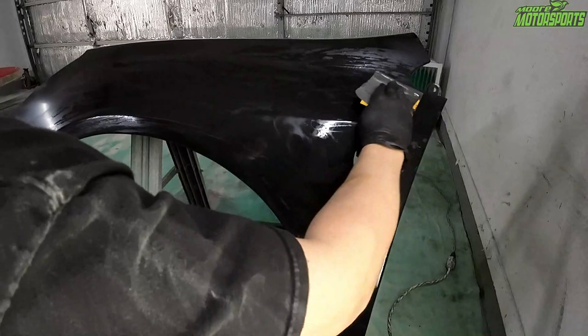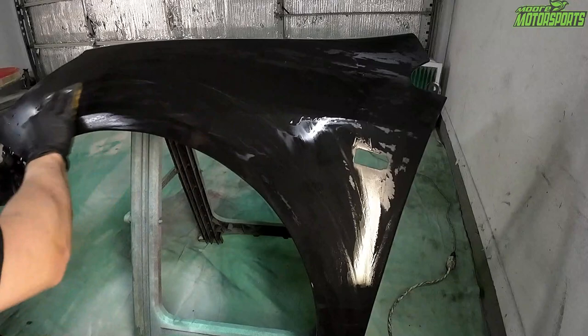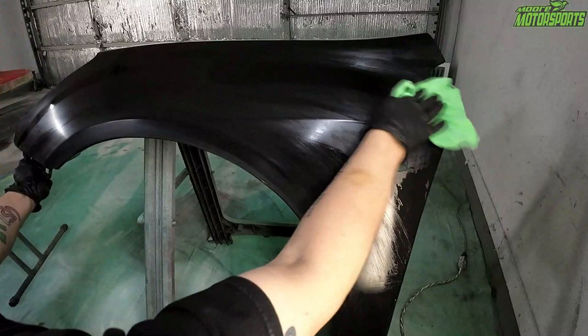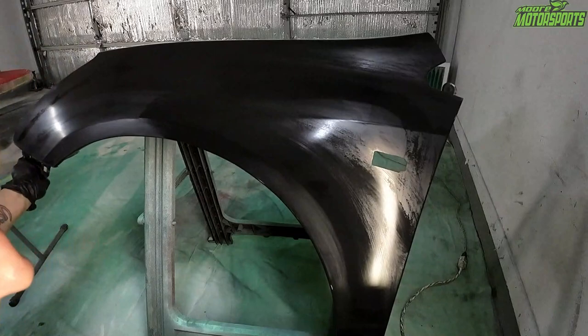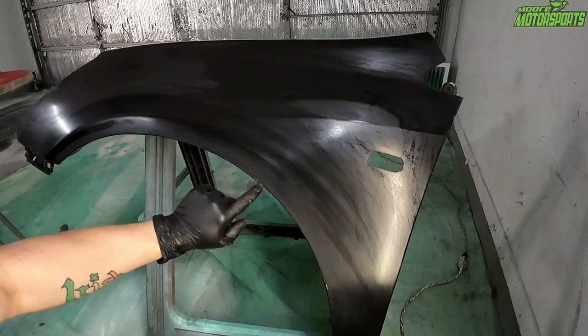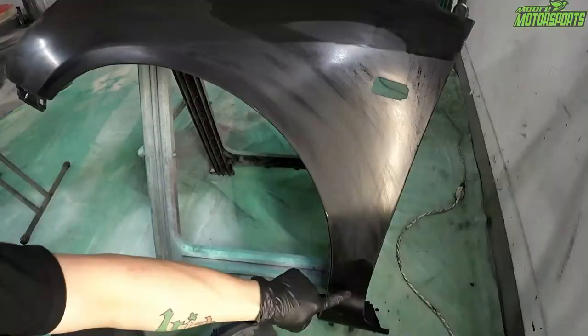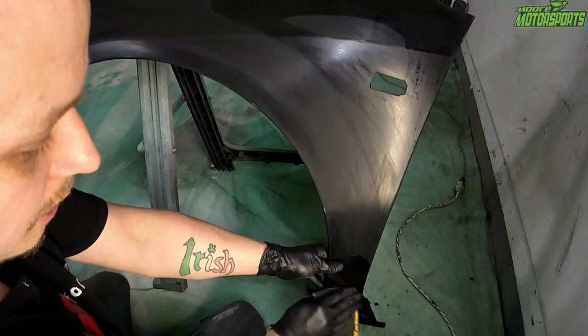You can even use Ace's spray paint — I've used that before, it's pretty good stuff. Now, when using microfibers, they can leave stuff behind, so just keep that in mind. But you can see it actually got some of that off there. We did burn through a very little bit right here and right here — some bare exposed metal. Thankfully, this Rust-Oleum stuff goes right over bare exposed metal and doesn't have issues with rust in the future. There's a little imperfection spot down here that's been like that since I got it, so I'm just going to clean that up a little bit and make sure it's nice and smooth.